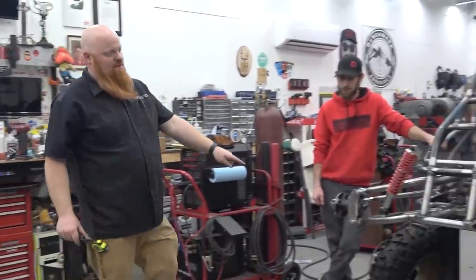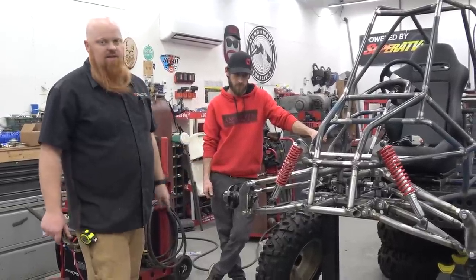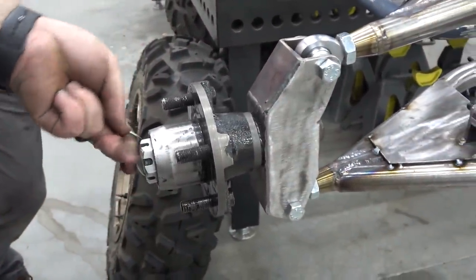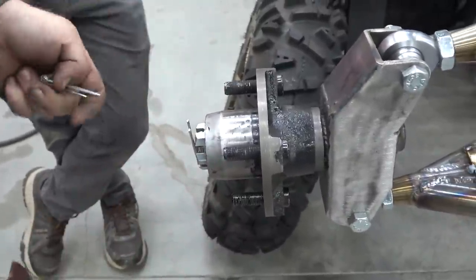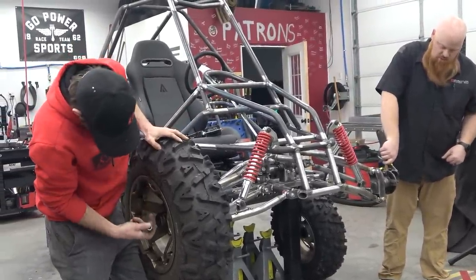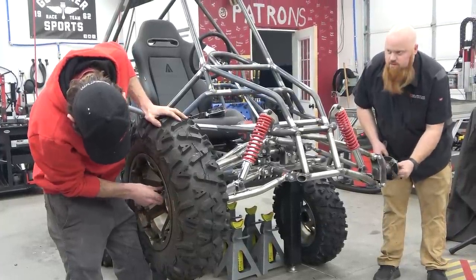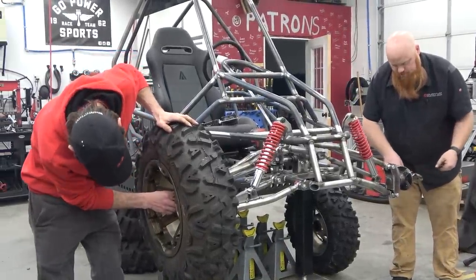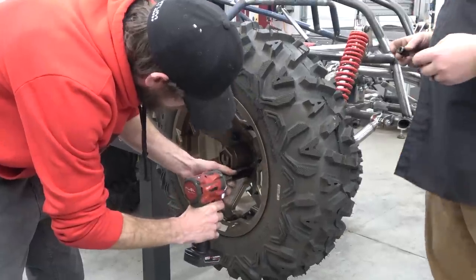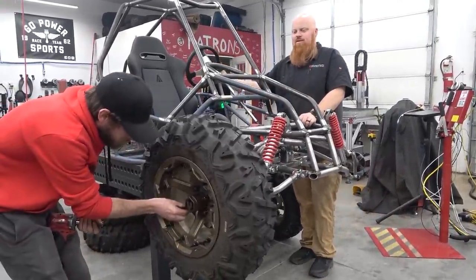We're going to put the front on, but we accidentally got the wrong shocks from Go Power Sports. That is the correct one — this one's about an inch shorter; you can see the height difference. These are the same brand wheels we put on the SEMA buggy and Lonnie's Deuce. They're really nice — these are the bronze ones, the LeBron series. My Ackerman angle's pretty decent. I'm curious how bad the angle is — that's how bad the angle would be if I didn't modify the spindles a little bit more.